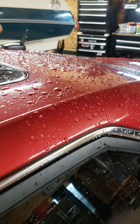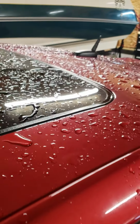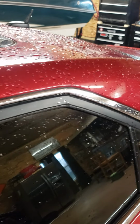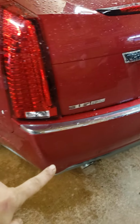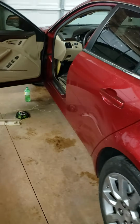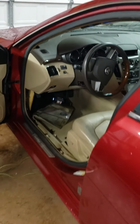There are drain tubes in the rear that you cannot get to at all. That glass does not move. The only way to get to it is to drop the entire headliner. I did check the back first. I let the water run down in here and hit this back seal. As you can see, the drain tubes come down off the back, around, and go underneath, and it drains on both sides. So I left that, because I knew my problem was in the driver's side only.